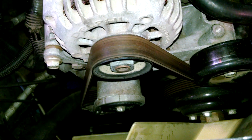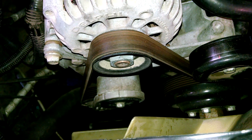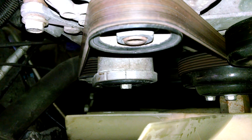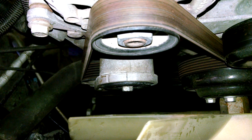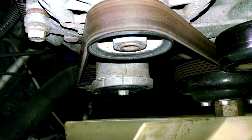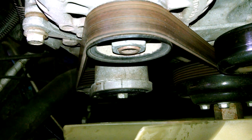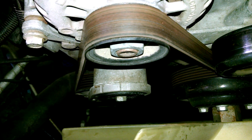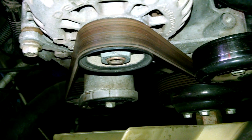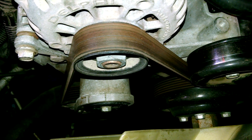Let's take a look at the alternator and tensioner setup. Here we can see the 2003 Chevrolet S10 pickup truck with a 4.3 liter, and you can definitely see a difference with the way the belt lays down there and the tensioner. This is with the shorter belt on the 2003, so I'd recommend using this 2003 belt because it looks like everything else is the same.